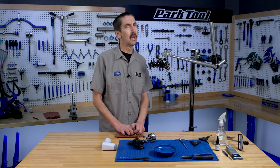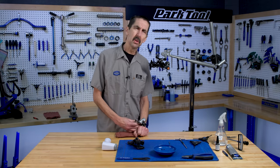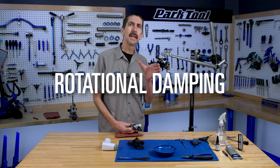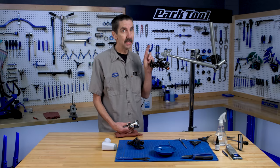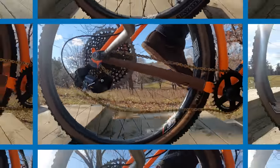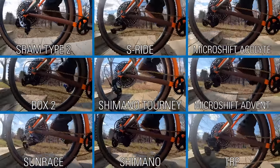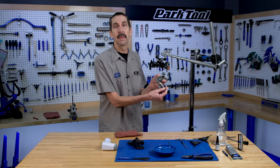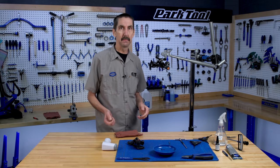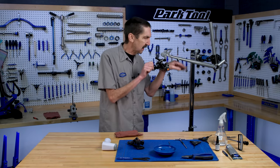What is this clutchness all about? Let's look at some older models that don't have a clutch. A viewer gave us a good term: rotational damping. It's going to take up energy in the rotation of the cage. In our chain slap video, it helps retain the chain on the sprocket, especially the front one. The older ones wind up the spring by shifting, but if you hit a bump it bounces back and forth. These new ones are hard to go forward but easy to come back, so we don't have all that energy slapping around.